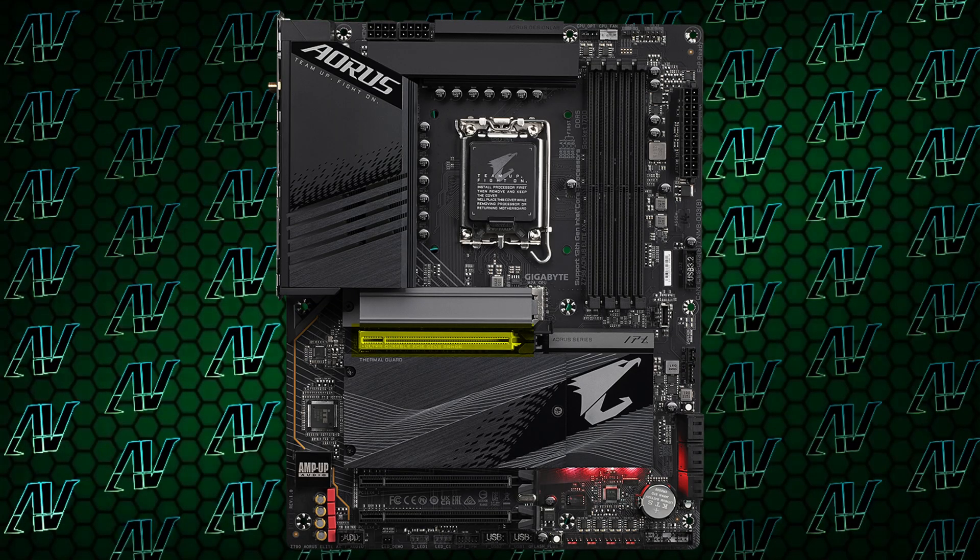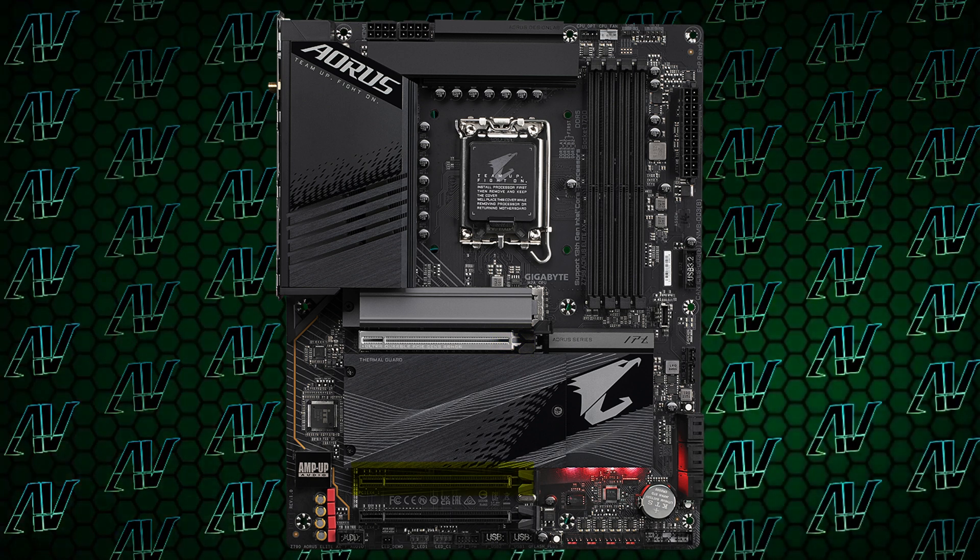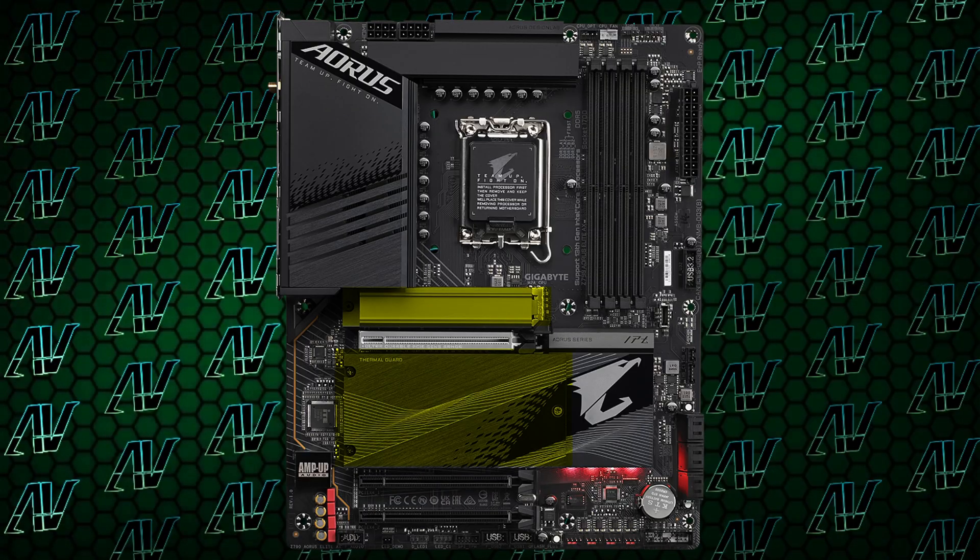Let's talk about something more exciting — at least as exciting as PC expansion can get, which for us tech nerds is very exciting. Things are pretty standard with a single PCIe Gen 5 16x slot and two additional physical 16x slots. Sadly, Aorus haven't given up their hatred of the 1x slot — I have no idea why they stopped putting 1x slots in, but it's painful to watch. We all can agree we don't want to be the monster that puts a 1x card in a 16x slot, yet Gigabyte are not giving us the option. At least you also get four M.2 slots.